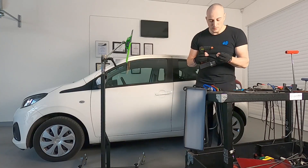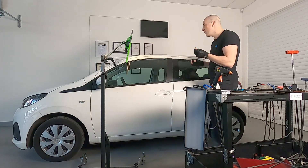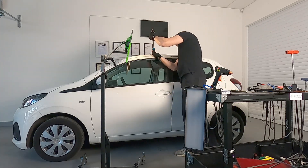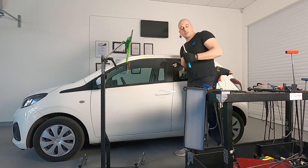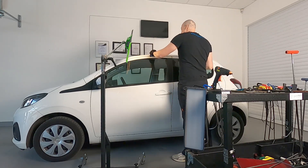Let's first talk about what glue pulling is and why we use it. Glue pulling is one of many techniques that you need to know to do paintless dent removal. It's used most commonly on the rails because there is no access from underneath — generally you can't reach it with a rod to push it, so you have to use a glue pulling technique to fix it.